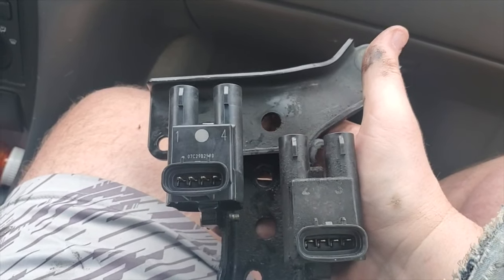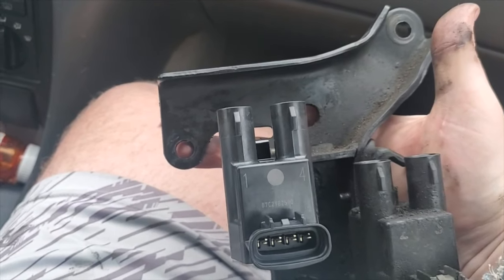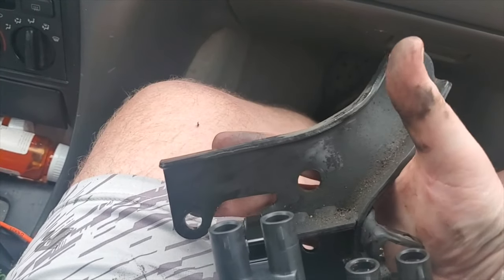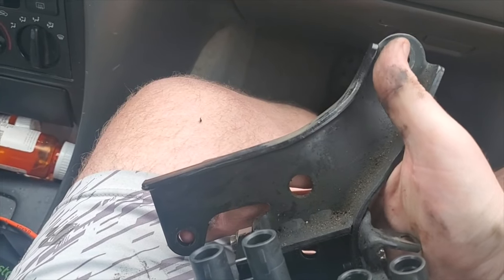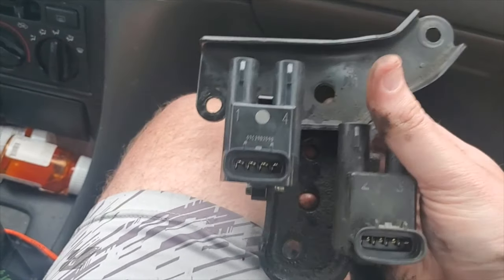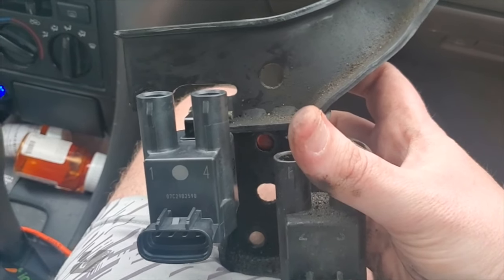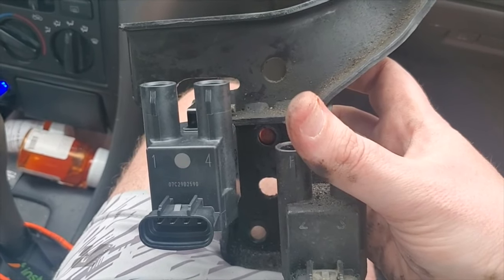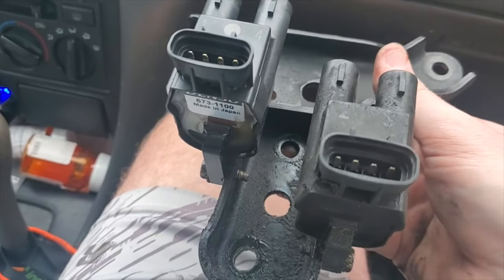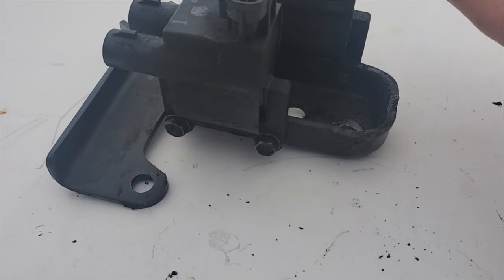I'm going to go over some things because I found a couple other bolts that need to get removed. First off, this bolt right here where my finger is — that's a 12mm nut. This here is a 15mm bolt. Make sure you put that 15mm bolt back where it goes. I'd align the nut up with the stud, screw that in with a few turns, put your 15mm bolt here with a few turns. Then there are these two bolts down here — these are hidden. These are both 12mm bolts, so you will need a 12mm socket, either deep well or regular, and a short or mid-range extension to get these bolts out. After that, you've got the ignition coil and the bracket freed from the car.